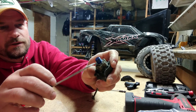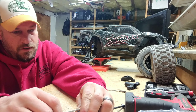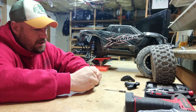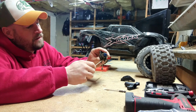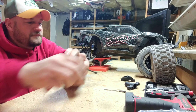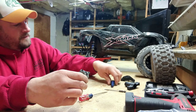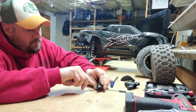I'll bring this in close for you guys. There's a little clip right here you want to pull off. I know for some of you this is probably elementary, but not everybody out there is a mechanic or knows how to wrench on their RCs, so I figured I'd do this video. Get back there, pry and take this nut off, and then you should be able to push that right through and this whole assembly will come right out. Next, push the bearings out — top and bottom.